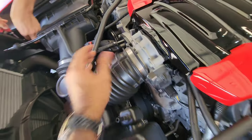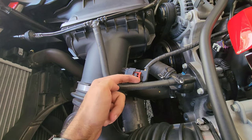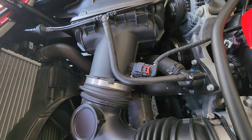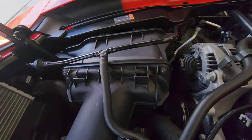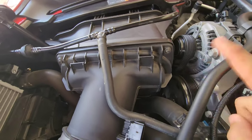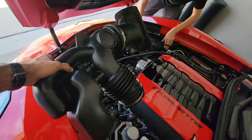After you get that bolt loosened, just work your way off of it. For this connector here, push that little red tab this way and then squeeze and pull out. We're having a little bit of trouble getting the whole intake system out, so basically what we're going to do — you see those two little bolts right there? They're Torx, T25 — we're going to get those two off so these two pieces can come out easier.